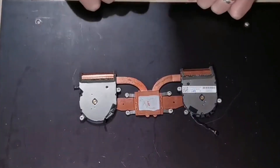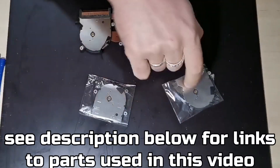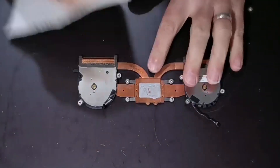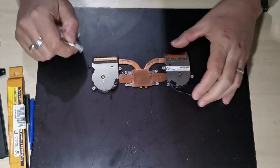The first thing we are going to look at is replacing the two fans on the heat sink, so first we have got to remove the old fans and fit the two new ones. The first thing I am going to do is clean the old heat paste off the heat sink — and I hope you'll agree, that's looking a lot cleaner.